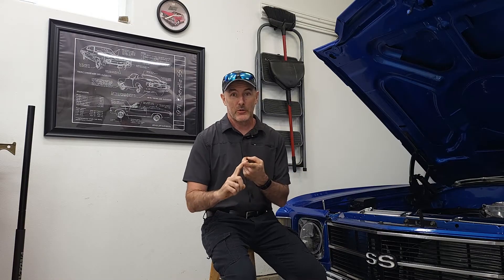So let's recap what we just went over. You've got your base timing — that's the one you set with your timing light on the engine. You have your mechanical advance; for an HEI it's 20 degrees. If you're running a Ford or Mopar, look it up and see what it is. You want to know what your max factory mechanical advance number is — here it's 20 degrees. Next is your vacuum advance, which is all over the board. In this case we're going to assume 12 degrees — a lot of people do 14 or 16, and you might end up there.